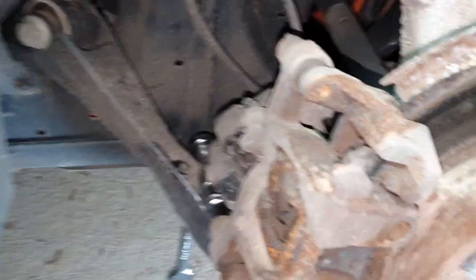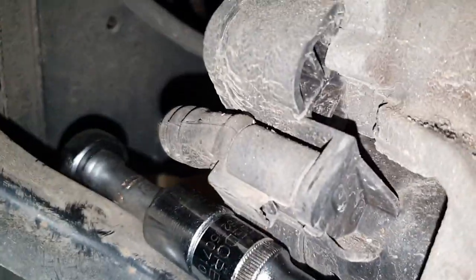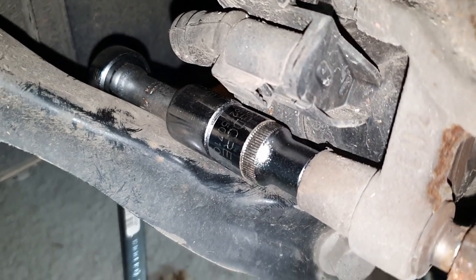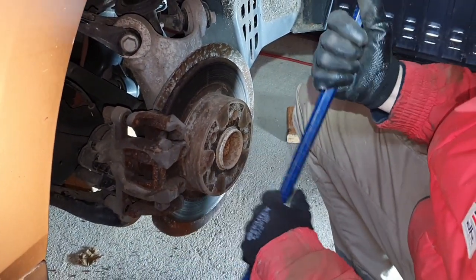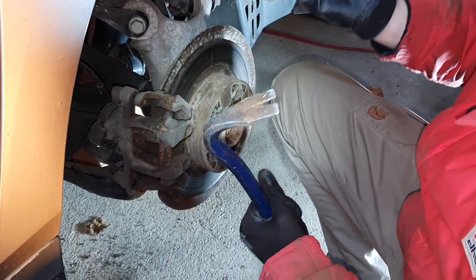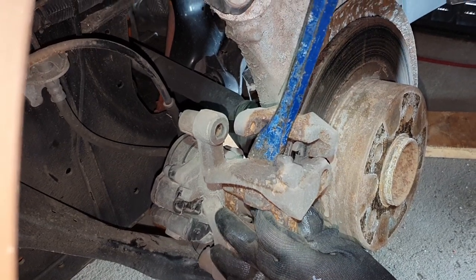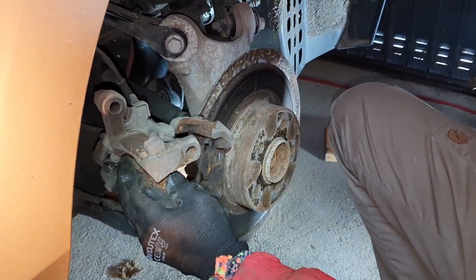As you can see, the pin is now nice and shiny. For the lower one, there's a bar holding on to the wheel hub that's somewhat in the way. You could push the wheel up with a jack so the bar goes down a bit, which would be helpful for removal. Once that bolt is removed, you can remove the brake caliper with a crowbar by pressing it in at the top and wiggling a bit. Press it in at the top, wiggle it free, and then you can just lift off the brake caliper.